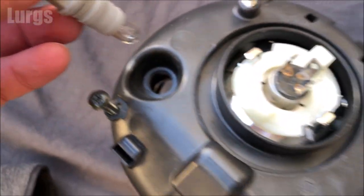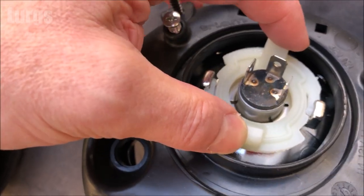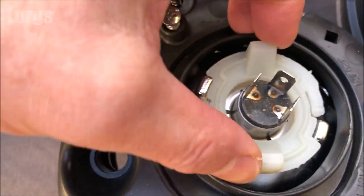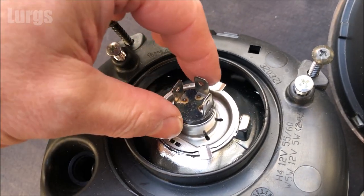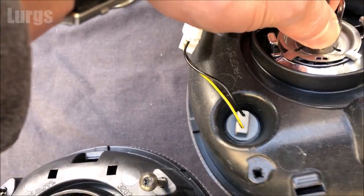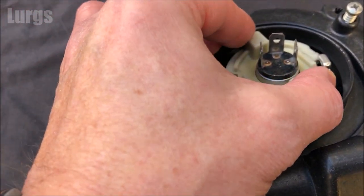What we're going to do now is just swap the bulbs over. I'm going to take the old parking light bulb — which literally just pulls out — and then just push that into the new unit. Then I'm going to remove the headlight bulb; there's nothing wrong with this so we can just put this in the new unit. Just turn that anti-clockwise about 10 or 15 degrees to lock it in. Don't ever touch the glass on this bulb — this is a halogen bulb, if you touch the glass it will get oily and then it will blow. Never touch the glass. Make sure you line it up in exactly the same position and put the locking nut in, just turn it to lock it in.